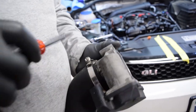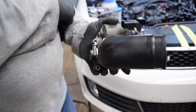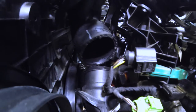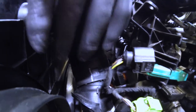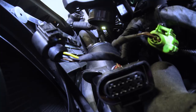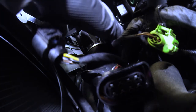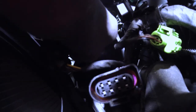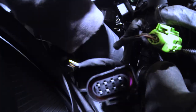Attaching the air intake hose on the throttle body was the second most challenging part of this — it was a bit of mud wrestling with a stubborn rubber hose in a very limited space. We actually made a mistake here: first we installed the throttle body with the hose on, but then realized to get the bolts on you needed the hose off for clearance. So we took the hose back off to get clearance for the throttle body bolts, then got the hose back on and reconnected to the throttle body.